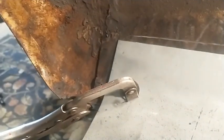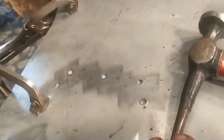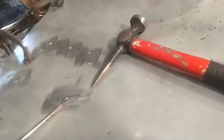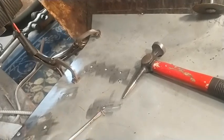I've got to cut across there and then just that little section there, spot welded in. I do have to plug weld this last crossmember — I've got a couple in it, but the sheet's popping around a lot, you know, that's what happens when they get warm. So I don't want it to oil can — no oil canning. So I'm kind of working my way to the front, and then I'll plug weld these, grind them off.